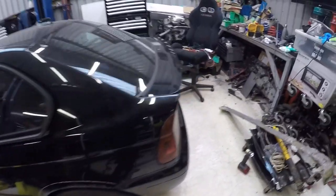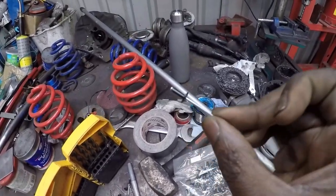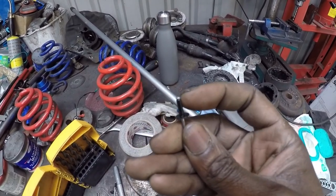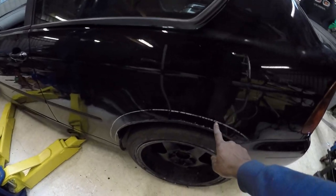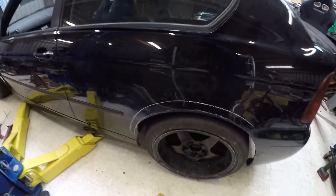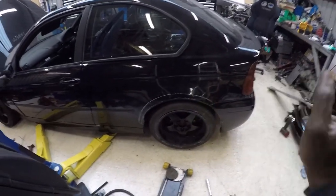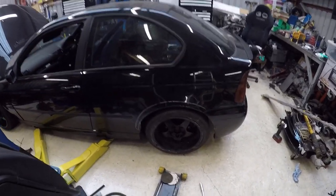And I've got the rivets in. So these are them black rivets. They're 3.2 mil diameter, and they're large head ones, so I can get cracking with that. I've already got my guidelines for where they're going to go. I think I'm going to drop them down a little bit from that line there, but that's my guideline on the front and back, so I haven't really got to work out where they're going to go because that's already been done. So I can literally just position them, drill the hole, and then rivet them up, and that should be it.